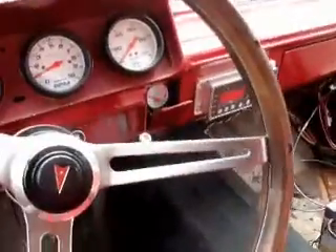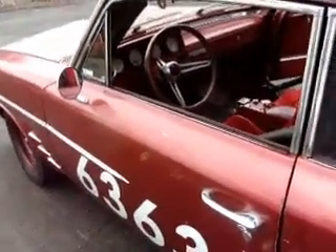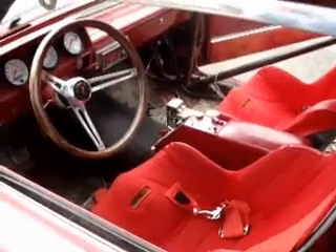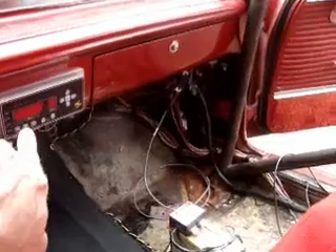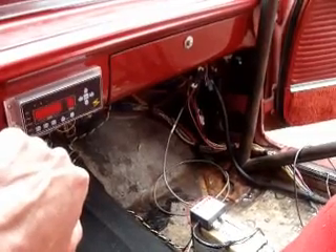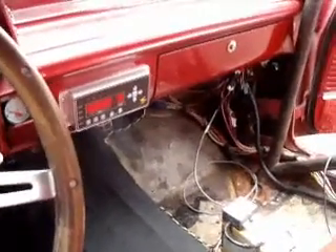That's about it for now. We can give you a little demonstration of how this works. John, do you have anything else to add? Well, it also has the option that when you get into the lights and stop in staging mode, you can actually release just the foot brake and it'll go to first gear. The tranny controller is hooked up to the brake, so the tranny knows when it's on the brake. So you have to have your foot on the brake when you push the arming button. For launch boost, this display will start flashing and you'll know you're in that mode — so there's no question whether or not you're in that mode. You'll feel the car go into third gear and then it's really easy to hold back to build boost.